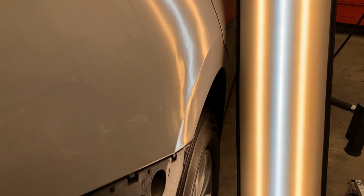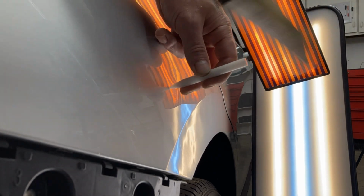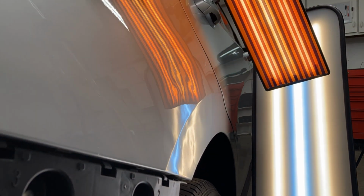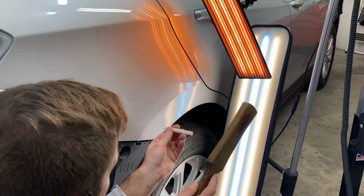But we got her. Just start massaging the metal. All the low spots, I just start massaging them. I'm using an R4 tip there with a soft cherry end on it. And here I'm just trying to level out some of the damage again, using a little pencil knockdown.